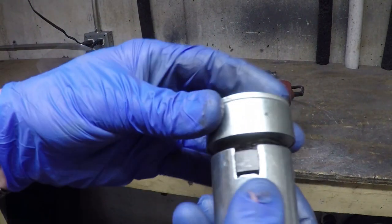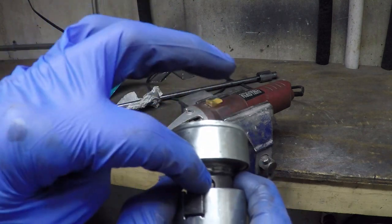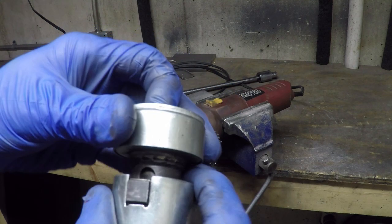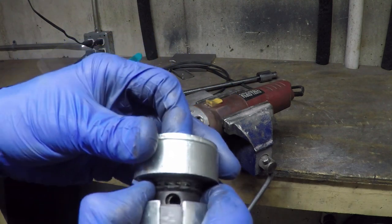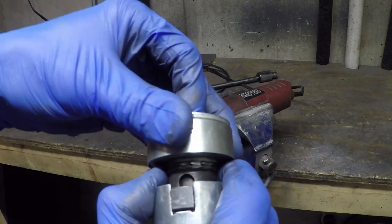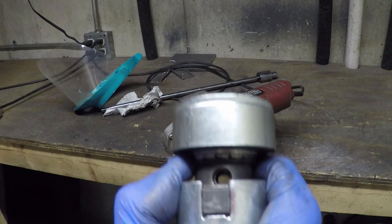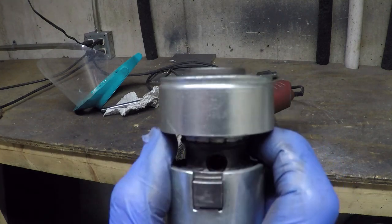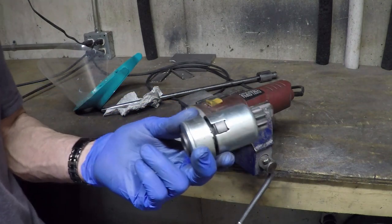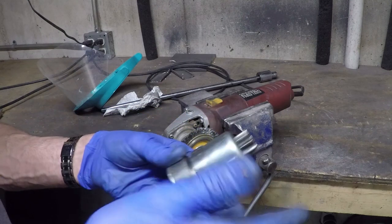When you reinstall this thing, make sure you don't open it up too far — open it up just enough to see the dowel pin. This dowel pin is in the wrong location, so I'm going to flip it around and rotate it carefully until it gets lined up just right. There you go — you can see through there. That is a funky tractor-style inertia drive starter solenoid.